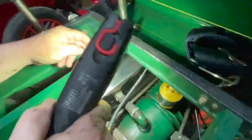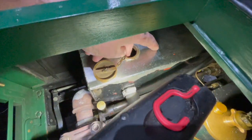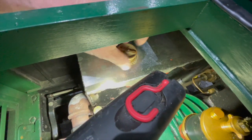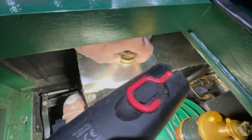I'll check the water. Basically all I'm going to do is dip my finger in. Yeah, we're okay with water and anti-freeze. A lot of people run these on waterless coolants to stop them overheating, which I think is a good thing, but you've always got to carry waterless coolant with you.